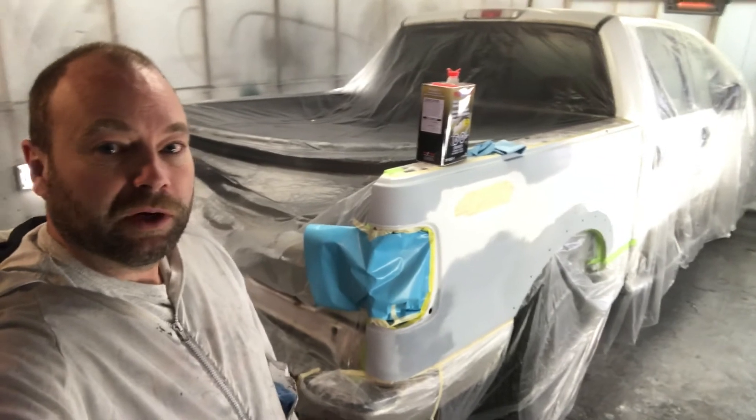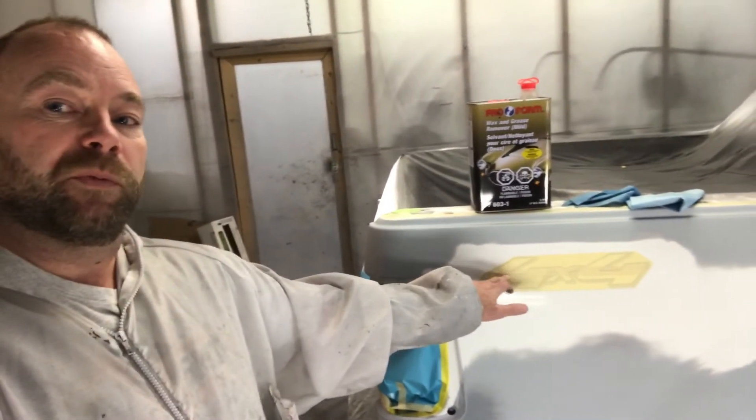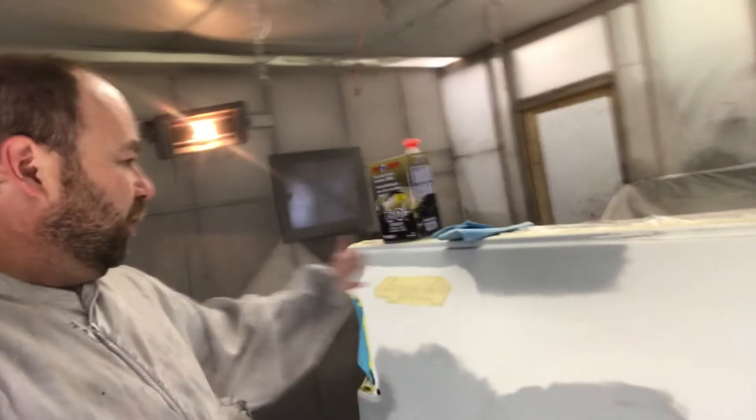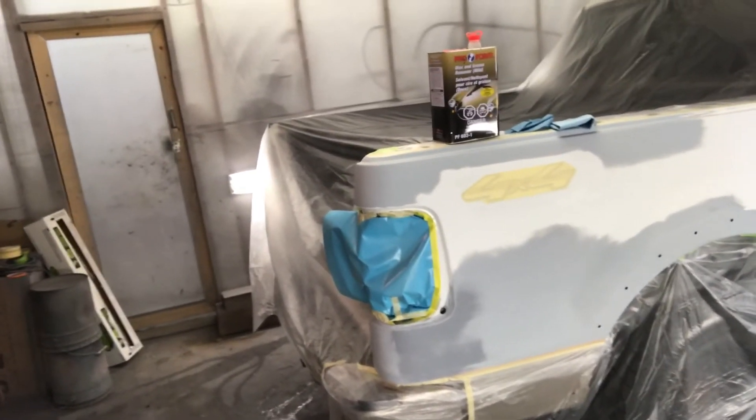So we're back in the paint booth, I've got the truck all masked up as you can see — all wrapped up with clean plastic, ready to go. I mentioned the 4x4 decal still being on the box. In this case it's an older pickup, so we're just going to save that decal. I've masked it off, we're going to put our color on, and then I'll peel that tape off before the clear coat and we'll just clear coat right over it. I also mentioned finishing the front of the box with 800 grit — when you're doing a base coat/clear coat system, you put the base coat over your repairs and stop the color there, and that's going to ensure we still have a factory color match from the box to the cap. The panel's been washed down with wax and grease remover. Next step, we're just going to run a tack rag over it quickly and we're ready to go mix some paint.